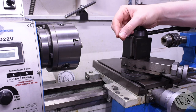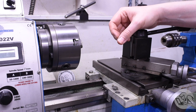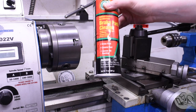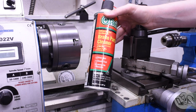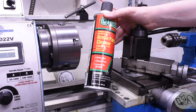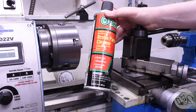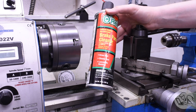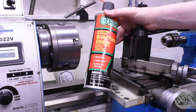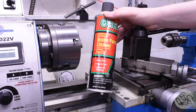It's pretty rare that WD-40 doesn't do the trick for cleaning off those protective coatings, but once in a while you get a stubborn section, and for that the nuclear option is brake cleaner. This is the holy mother of all solvents as far as I'm concerned — I've not found anything that this stuff won't destroy. But with that great power comes great responsibility. Be careful with this stuff. Don't use it if you don't have to, don't breathe it in, don't use it around dogs. It's nasty stuff.